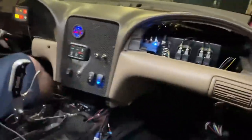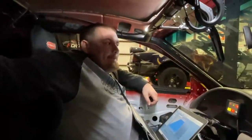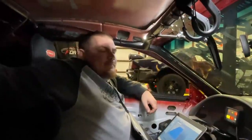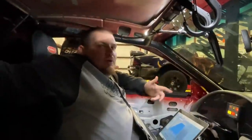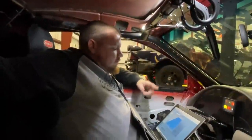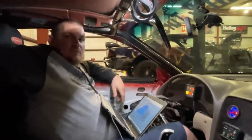Transmission temperatures are less than 140 degrees — I'll take that. But you do need to get a manifold air temp sensor in this, because I can't tell what it's doing. I'm not cycling water through right now and we don't even have any ice, so she's spicy. In order to get that manifold intake air temp, I gotta pull that intake off — yeah, because all the plugs are underneath it. We gotta get below that intercooler to get an accurate reading. Right now we're going for 8.50s — we're not trying to kill the thing — so we'll make one more pull and see what it does.